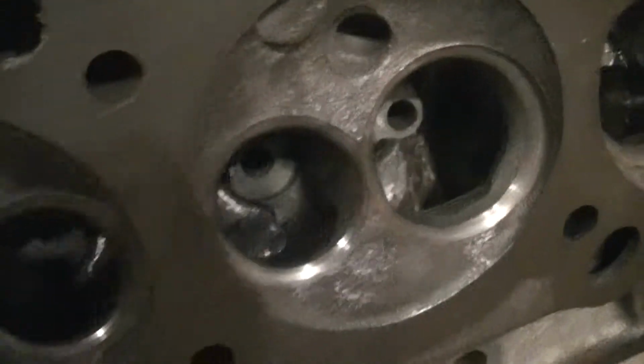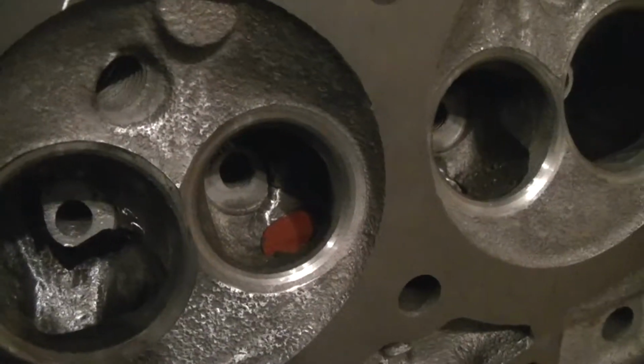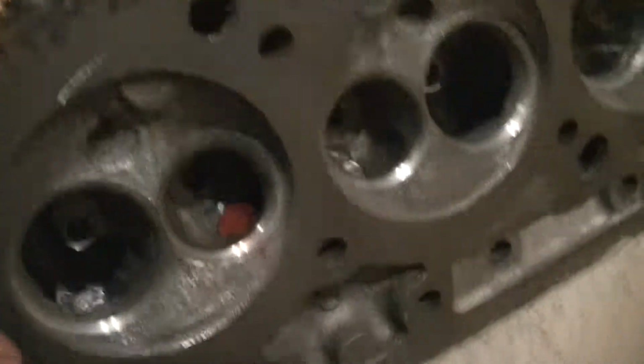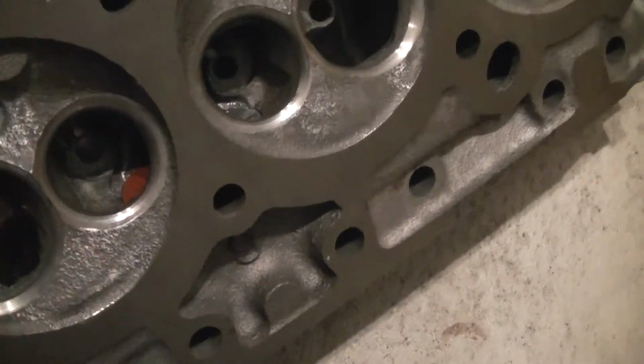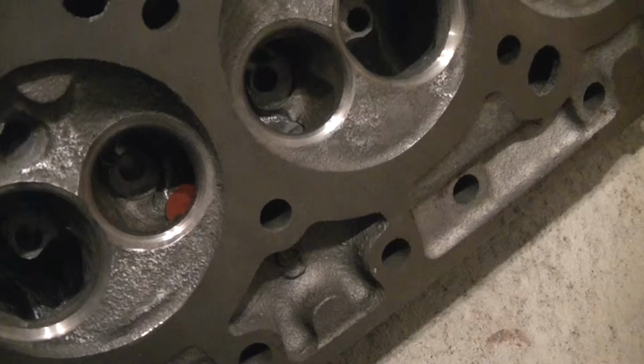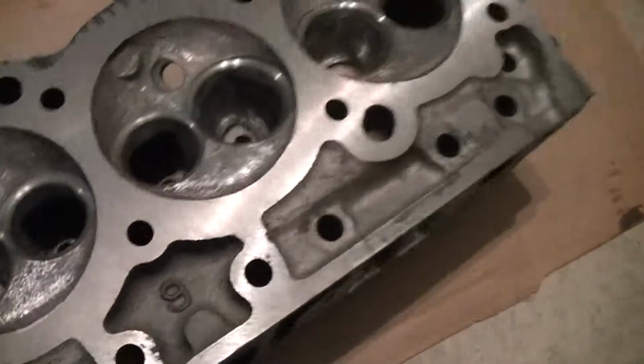There's a shiny one there. See the silver in there. That's the steel rod coming through, plugging up that hole all the way. A freeze plug would leave a big gap in there, so you'd still have air turbulence. You know, the air wouldn't swirl around as good in here. But with that plug coming out through the end, it eliminates that turbulence, and doing this will give you a 10 horsepower gain over what it was before.